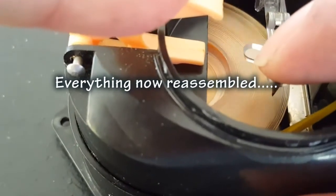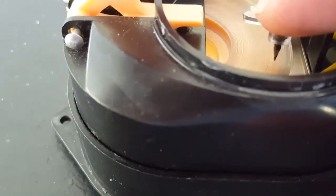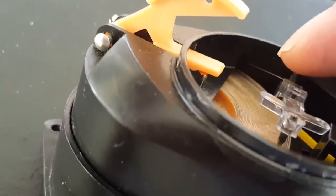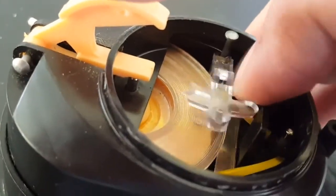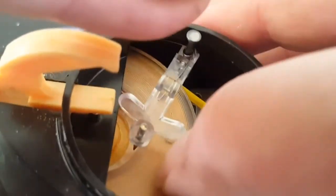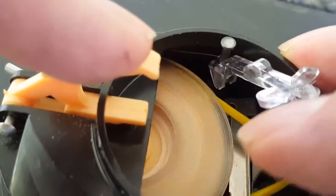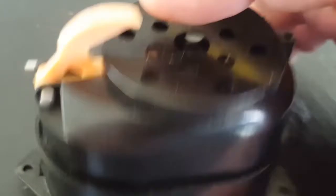You can see it works. I'm going to talk about that spring arm - you can see here how it comes out of the stylus and round onto that black piece which puts the tension on it, so it springs back when the mechanism finishes. When you press the start button, that springs down and then that needle engages on the record, moves across, and then that goes up - that's where that spring is critical. But I'm not convinced - I think that's a bit tight, but let's see.